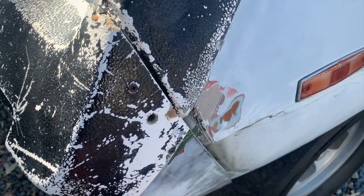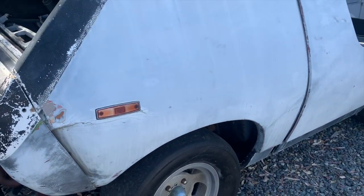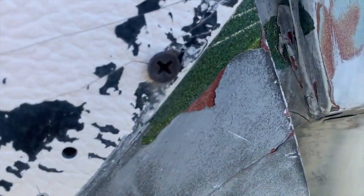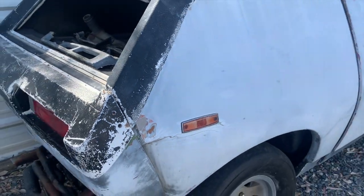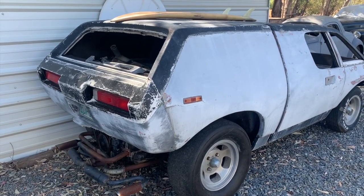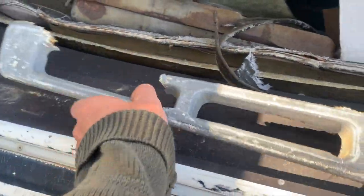Looking at the rear bumper, along this edge it's a little chipped up — I'll have to do some repair there. There are some small cracks in the body, but a lot of body work looks like it has already been done to the sides; it's really quite smooth. With some minimal finishing I can get that back to a paintable surface. Looking close, that metallic green looks to be the original finish on the car, which is awesome — in every photo I've seen of these, they're all in a warm color: maroon, orange, red. Doing one in green is going to be really fun.